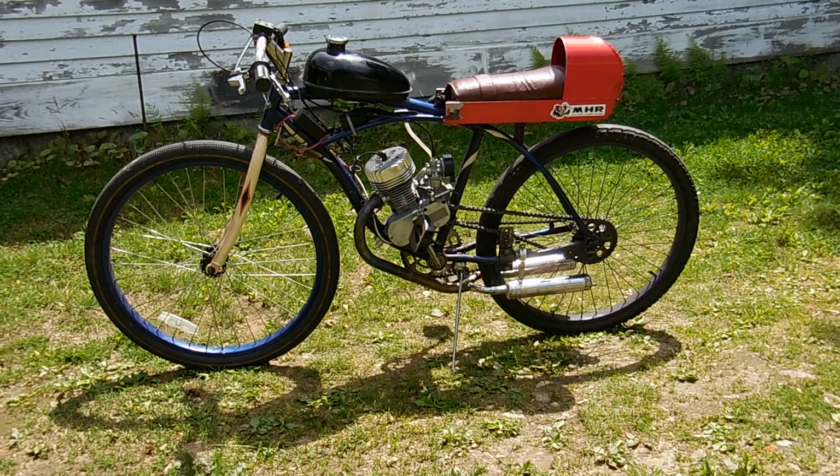The Super Rat, I must warn you though, the Super Rat engines, I've received about 10 of them. And from what I've found, about 60% of them are unacceptable. You hear that? They're unacceptable. And they are going to be disappointing, as I'm sure some of you who have purchased this engine will probably be scratching your heads about why the performance of that engine is not good. Well, I'll tell you. It's because the connecting rods are bent.